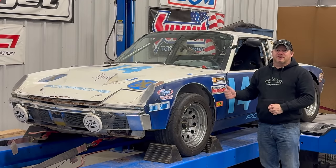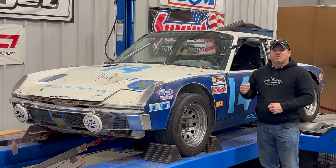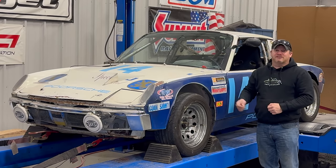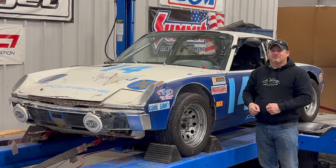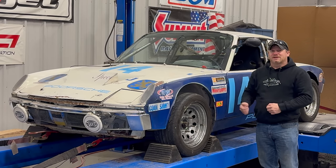That's going to be it for today. You probably saw on the dyno that the rear end of the car was going up and down. That's probably because the tires are flat spotted from this car sitting for 10 years, and the wheels have been raced on quite a bit — they're just steel wheels, so they might be dented from hitting rumble strips and things like that. This type of wheel is normally meant for dirt racing and you don't see these on a lot of road race cars. They are very heavy wheels and obviously they dent pretty easily. That shouldn't have affected any of the dyno results. But I think if the car was driven a bunch more and had good fuel going through it, it probably would turn even better numbers. This gives us a really good close approximation of how much power we're going to see going through those axles and the transaxle.